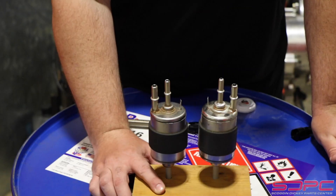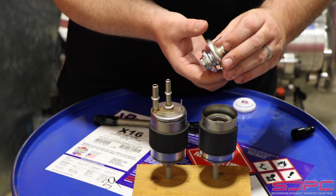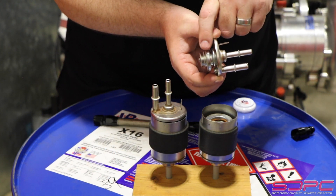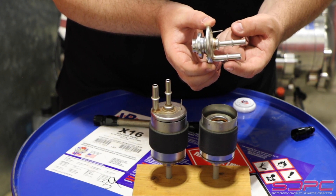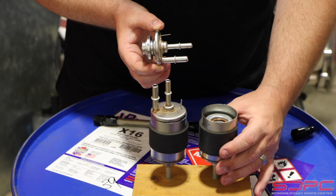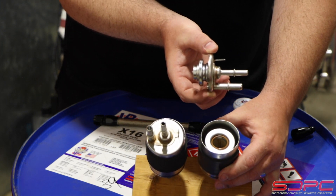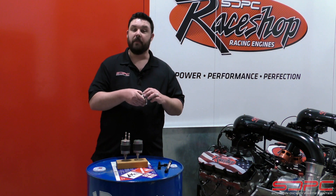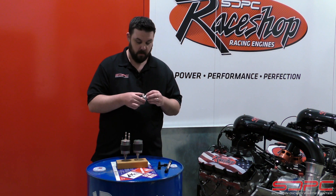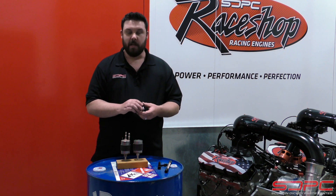It's a pretty neat function on the inside of this. It has a fuel pressure regulator built into the center return port, and that's how it works. It goes inside, gets filtered, and whatever excess is going to come out, it comes out in that center fitting. 58 PSI is what this requires for your swap, and this is exactly what this regulator does. Keeps it real simple.